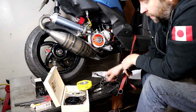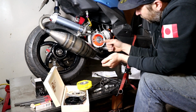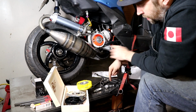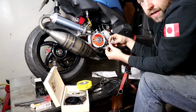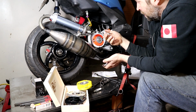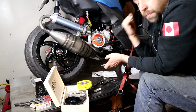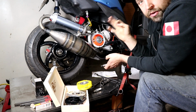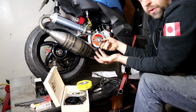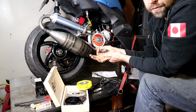Oh, and one other thing I kind of glazed over, which I shouldn't have. When you set the 0 point of this, wherever this is, when you have 0 set, even if it means you have to go back in and refine the top, exactly top dead center, it's a little bit easier to do with a dial, like with an actual dial. The problem is on this bike, in order for me to run a dial, I gotta take all of the panels off of it. I don't really want to do that, but you will get much more accurate with a dial indicator, so you can sweep it and find the top point. This is a little bit cruder. It will get you close, and then you can do fine adjustments with a timing light after anyway.